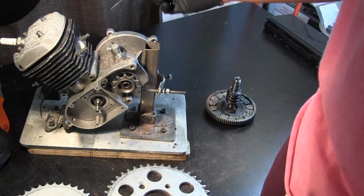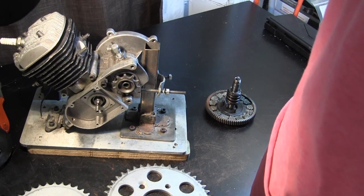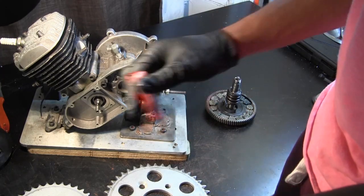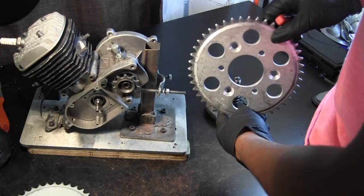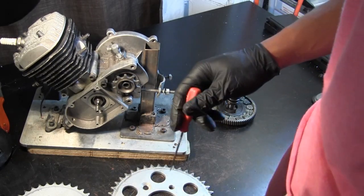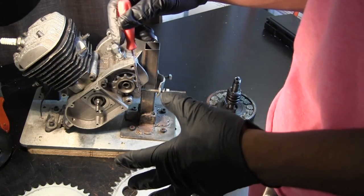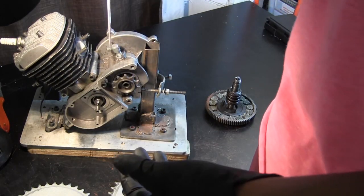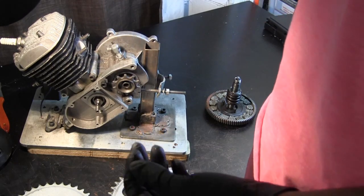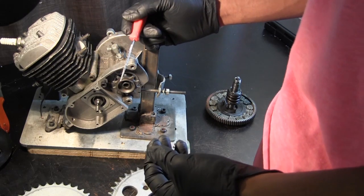So we get the first ratio of 20 to 82, and then the second ratio is 10-tooth to whatever size sprocket you have — in this case a 10 to 44. That's what we'll be inputting into the program. If you have a tachometer or have an idea of your engine RPMs, you can input those RPMs and that'll give you a theoretical top speed for your setup.